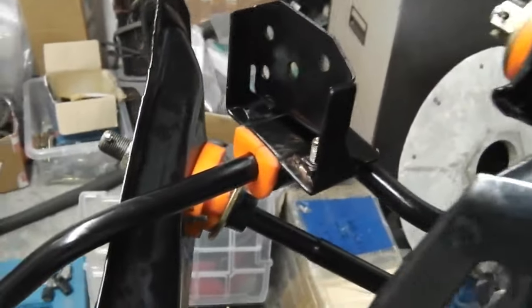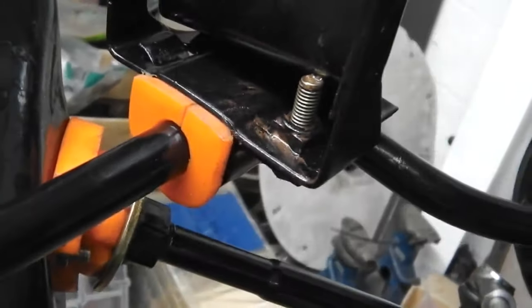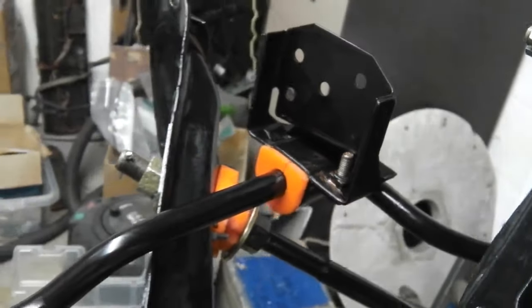Okay, gonna have the front for the anti-roll bar brackets there, inboard now. Those anti-roll bar bolts you see are too long. See how it's just starting to touch the inside there? It's actually tight before it hits it, but it's very close. We'll swap them out in a minute.